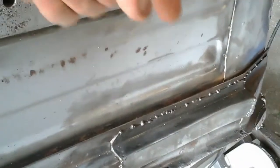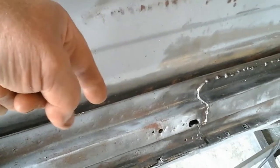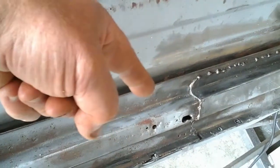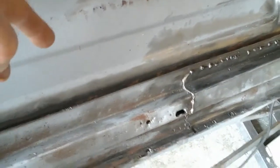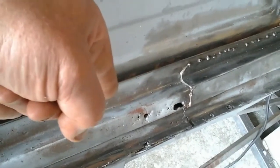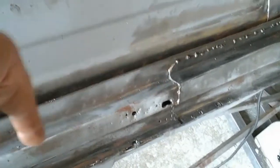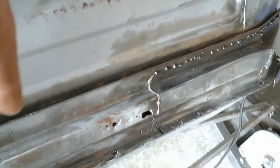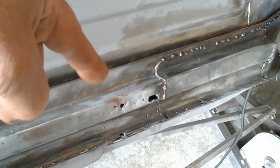As I was showing with a pick in an earlier video, I took a pick and stuck it down in here, and there's enough room across this whole area. When they remove the old floor pan, I think we're going to end up with another layer of metal between this frame rail and this floor pan. We're talking about fabricating a better quality patch panel to replace all this, but we're also discussing how we're going to do that if we have another piece of metal sandwiched in between.